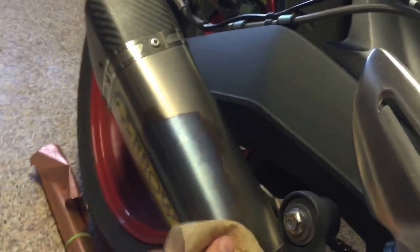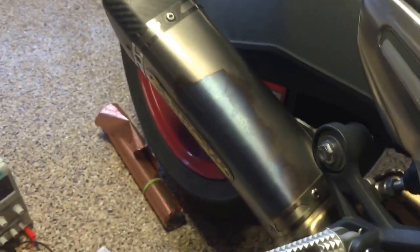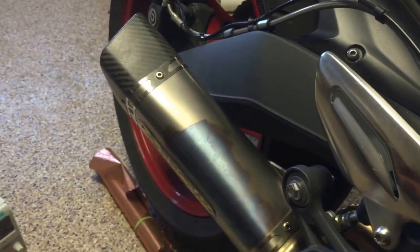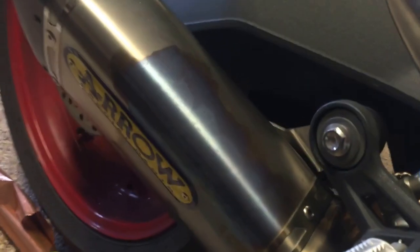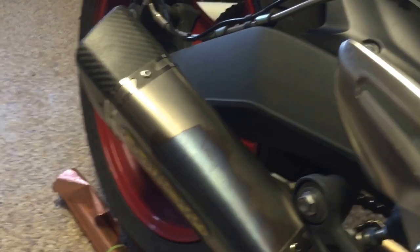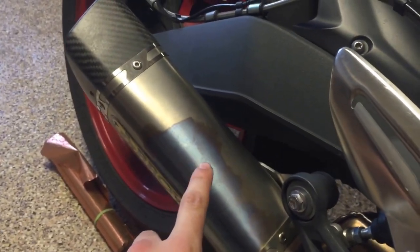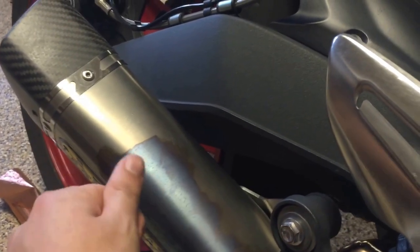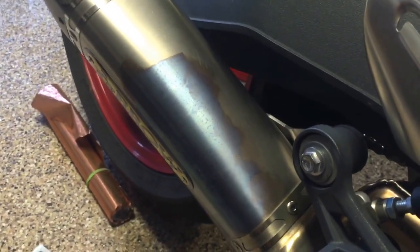Being careful, you press the foil through the paper towel against your exhaust, and you'll hear a slight sizzling — that's the anodization going on. You want to not leave the foil on a spot too long, because the color changes with the amount of time you hold it there and you could go too far. Here I've had it on for quite a while and you see this beautiful metallic light blue effect. If I held it on any longer it would start to turn darker. So you want to move it along the exhaust at a slow, steady rate. Mine's a little blotchy where the copper foil was sitting — that's because I held it on one spot then moved. I recommend you keep it moving, one stroke, two strokes, keep going until you have the color you desire, to keep a smoother look across your exhaust.